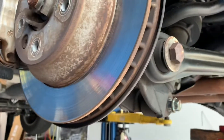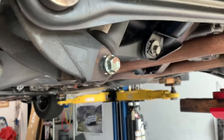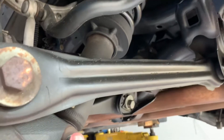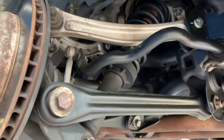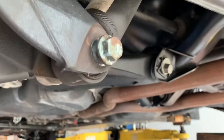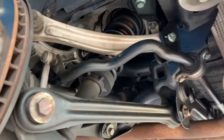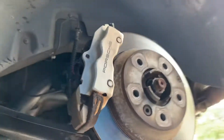Here's the wonderful part about this: the strut wants to push down further than the hub is willing to come down. Most cars you have to jack it up just a little bit to get everything to fit. In this case the spring is under tension just sitting there in free form, so when you take this bolt out — which we've loosened already — you want to support the bottom of this or things are going to get pretty exciting. One day you can ask me how I know. But that's the actual strut housing.